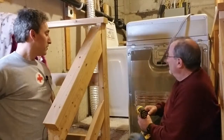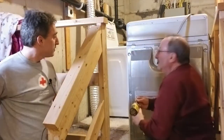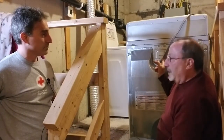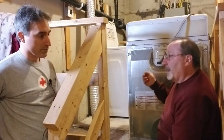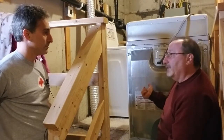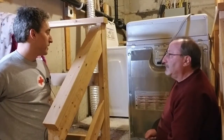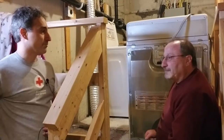So why don't you let me know what were the couple of things that you started with? With power on, check the door switch, make sure the door switch is functioning — we can hear that click, and also see that the light comes on and off. So it does two things: power is getting into the dryer, and the door switch is functioning.